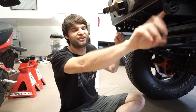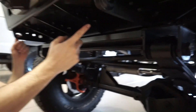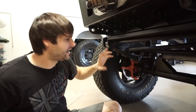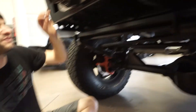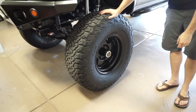If you wanted to shorten the pedal throw you could fit a master cylinder with a little more volume, but it works perfectly. It holds on steep obstacles and stops fine on road. The front bumper also has recovery points, reinforcement plates under the winch to prevent twisting the bottom plate, and an extended diff breather. Now let's walk around the side of the truck.